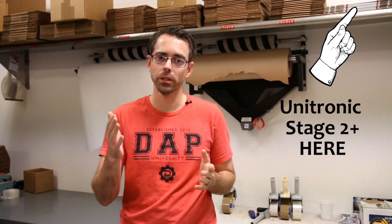Okay, Alexander, you have a stage 2 GTI and you're looking to upgrade it. Just want to clarify something before we answer the questions. You mentioned going to stage 3 — different manufacturers use different verbiage. APR's stage 3 is not an IS38; it's actually a bigger turbo than an IS38. For example, Unitronic — we are a Unitronic dealer — they consider an IS38 upgrade on a GTI to be stage 2+, which is the gap between stage 2 and stage 3. Stage 3, if and when they come out with it for the Mark 7 GTI, I anticipate Unitronic will have a big turbo as opposed to the IS38, which is a turbo upgrade, but not a big turbo by any means.